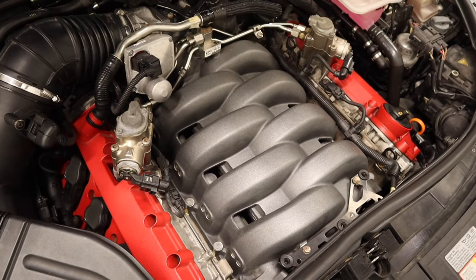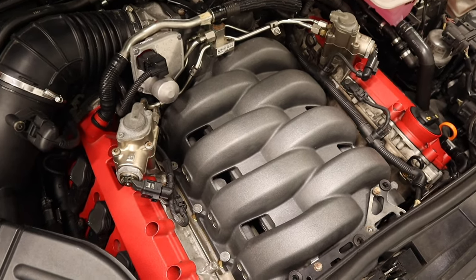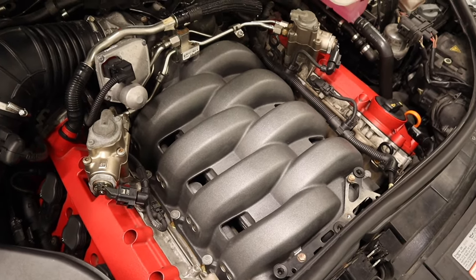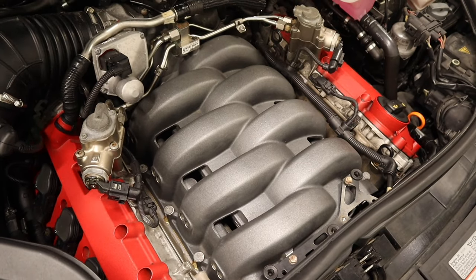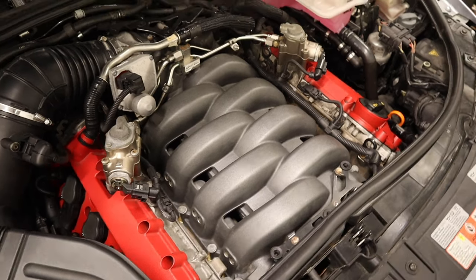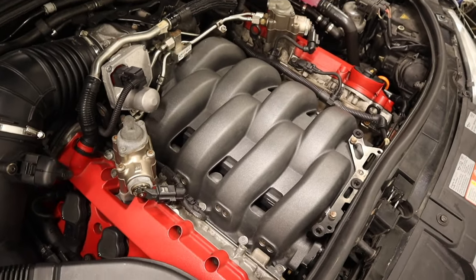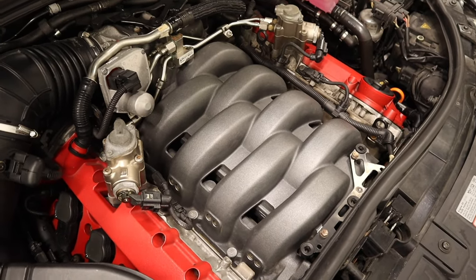On some more technical aspects for people actually doing it — I have the DIYs on this car. The absolute biggest thing I'm going to say here is: remove the flaps. People lose engines over the years because of not removing the flaps. The flaps fatigue, the screws back out, even if you go to put them back after cleaning. Unless you're getting a brand new intake manifold — and I'm a forum geek too — these are very specific cars. To skim over the flaps issue: they are metal, there are 16 screws, and they can fall in and cause catastrophic engine damage.